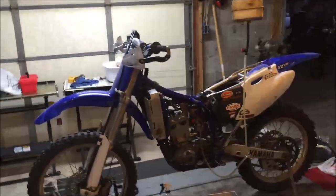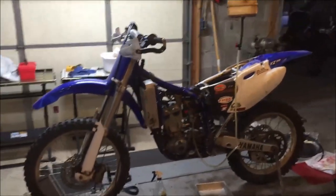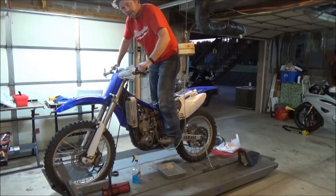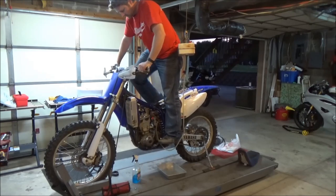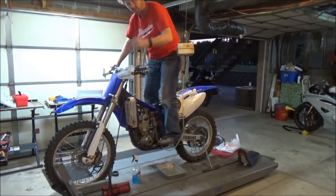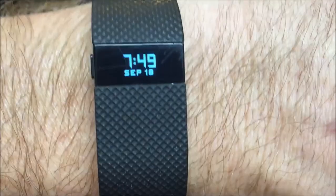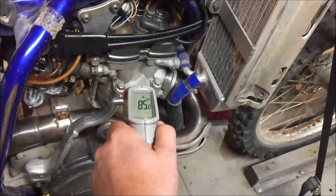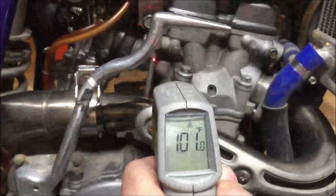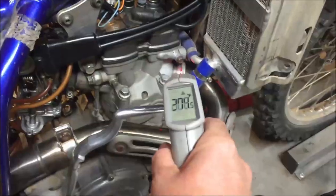I don't have the lever on the handlebar, but I'm still gonna use that procedure — that'll help you 2001 to 2002 people out. Let me kick it until I feel it get hard, let it re-ratchet, and now... I want to prove this was a cold engine that I'm gonna get to full temp — to show you that when tuned right and using the procedures outlined in the manual and common to be successful on forums, this works great. Check it out.